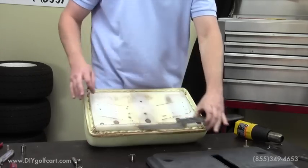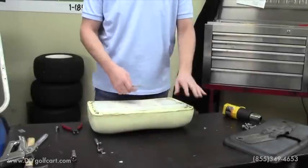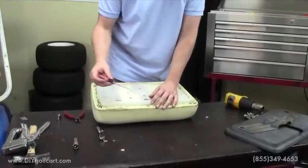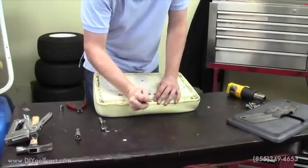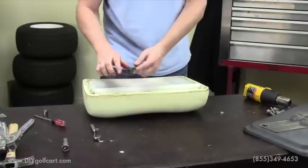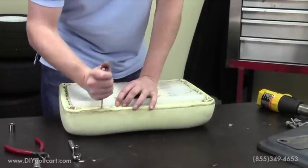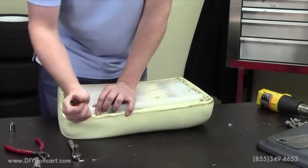This is the bracket that will have the seat back supported to the bag rack. Once we've got the back cap removed, our next step will be to remove all the staples found around the perimeter of the seat. In order to do that, we'll take a flat head screwdriver, put it right behind the staple, and pull it straight out. Now some of these staples will get stuck, and if that happens, we'll just grab some wire cutters and pull them out as well.